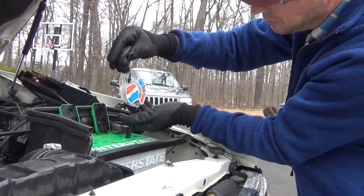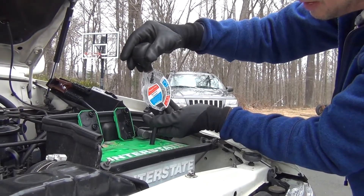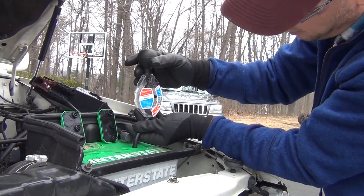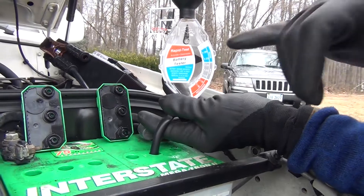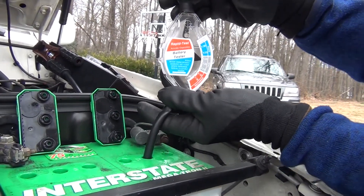Okay, now let's check this next one. Let it fill up — you want the liquid to be all the way up, but as long as you completely cover that dial it's fine. It's at 1.275 again. So those two cells measured exactly the same specific gravity. That's good news so far. Let's keep going.